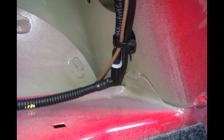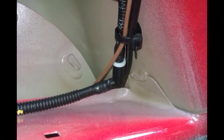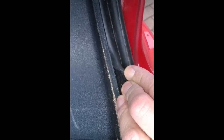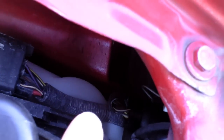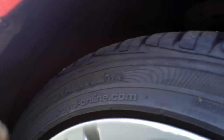With this panel out of the way you should be able to look in and locate the water pipe. When you put it back together, just remember to use a little bit of glue or perhaps a jubilee clip. Be really careful when you're putting back the panels, and don't forget to push the rubber seal back over the plastic panels again. That's the three main areas where these pipes normally pop. However, if you're still losing fluid at the front of the car it may be that the actual motor itself has popped out of the reservoir. Unfortunately that's buried right deep into the wing, and the only way you can get at that is to jack the car up and actually remove the plastic inner wing liner.